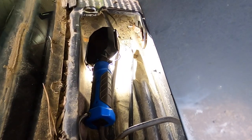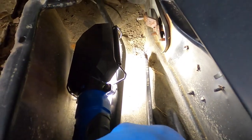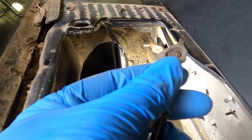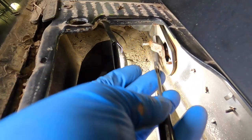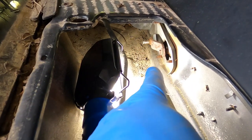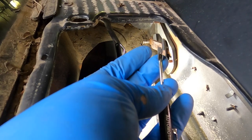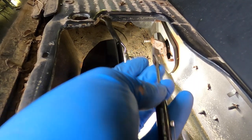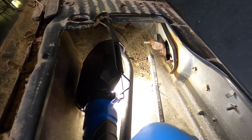Just a quick tip — I always try to share these. If you're trying to get your cowl grille out, there's a wiper arm right here. The way to get it loose: there's a little clip on the end. I had to get a screwdriver in there and kind of bend it, and it came straight down. So if you're having trouble taking the wiper motor out, you can stick a little flat head in there, push it down, bend it back — it'll come right off and then you can get the piece off. Now I can take the wiper motor off.